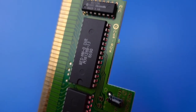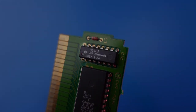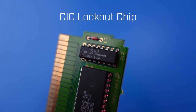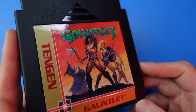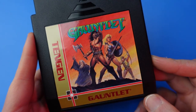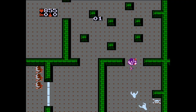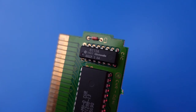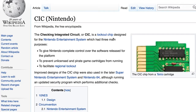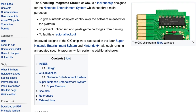Finally, let's talk about that 6113A chip labeled CIC on the left side of the board. That's called the CIC lockout chip, and it was used to make it harder for third-party publishers to create games that weren't officially licensed by Nintendo. Without that chip, or at least one that mimicked that chip's behavior, a game will not correctly play when slotted into an NES. The CIC chip is a whole topic unto itself and it's way outside the scope of this video, but for those who are curious, I've left some links to further information about its history and operation in the description.